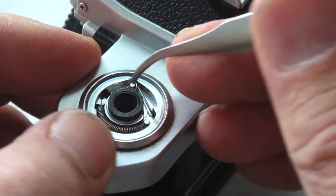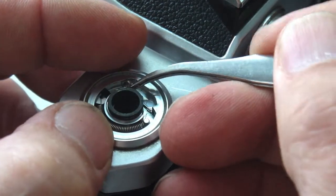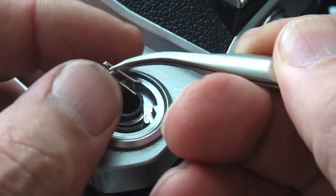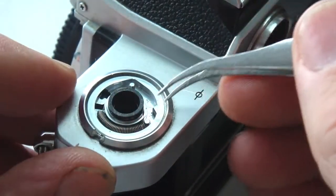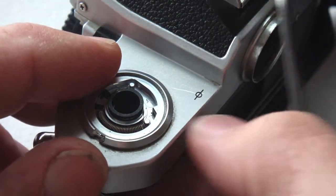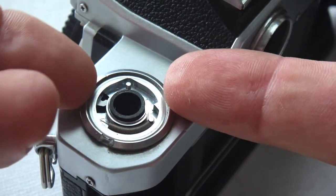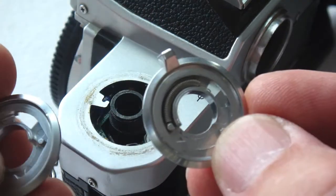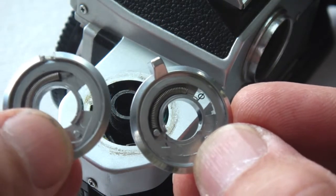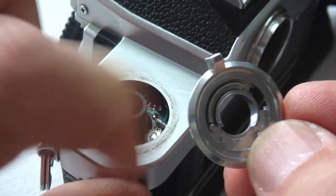Keep the fingers of your free hand over the springs as you use tweezers to remove them, so that they don't fly across the room should they become disengaged from the tweezers. Using your fingernails, you can lift the old latch free and drop the new latch knob into place with the spring already in position. That's the return spring.